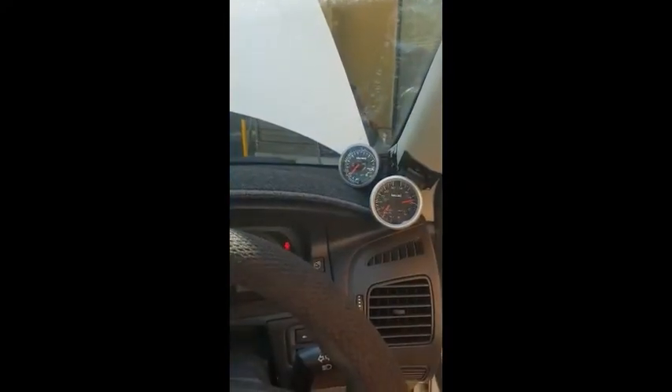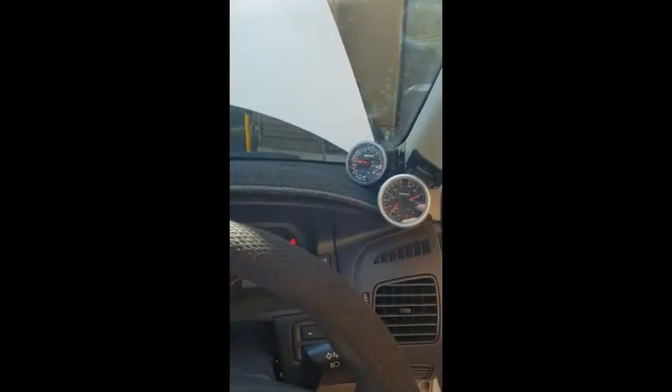This is a dead spot I'm talking about when it comes to just off idle. It should be cycling and it's not at the moment. It's running lean. If I put it in reverse and just start to touch the accelerator pedal, it just doesn't like it. I've got my foot on the brake, but if I gave it a whack — that was in reverse, same with forward. It doesn't like it. It's not near as bad, not stalling at least.